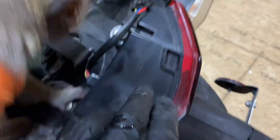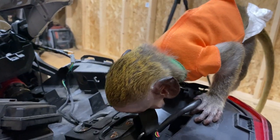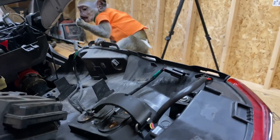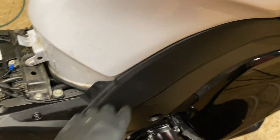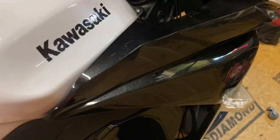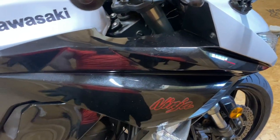Mojo is inspecting my work, making sure I'm doing it right. He stores food in the side pouches of his cheeks for later. Now, the tank area is pretty tight here, so if I take these bolts off I risk scratching the tank. This cover also needs to come off before removing the tank. The easiest approach if your bike is already nice is to take off the outer fairings first — that makes removing the tank much easier.